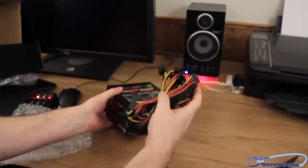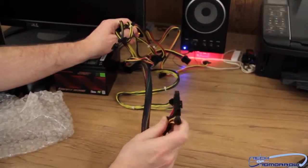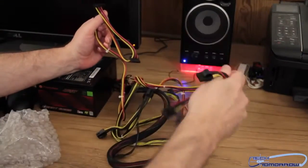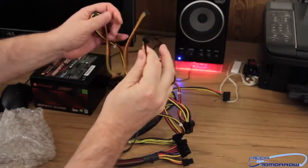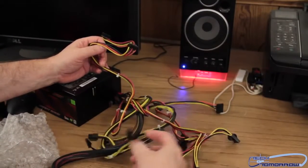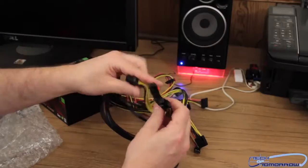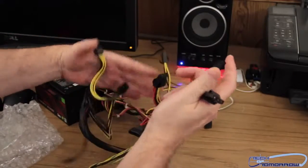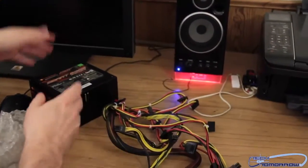Now let's take a look at all the connections. You've got the 24-pin power right here, all your main power, VGA power, more VGA power, lots of connections for your SATA devices, and a mini power port as well. Looking at all the connections, it really looks like you're only going to be able to use one video card with this power supply — it does not look like it will support multiple cards due to the lack of connectors. It does have lots of SATA connections, and some motherboards with onboard power will also use that slot for extra power to the motherboard.